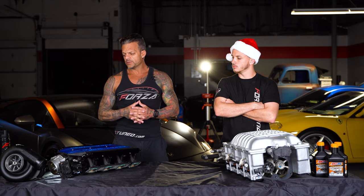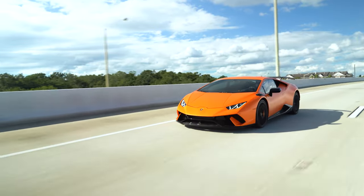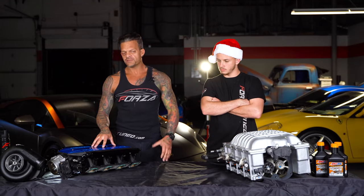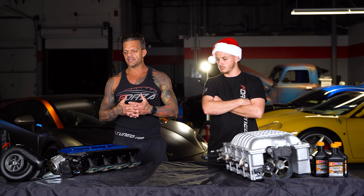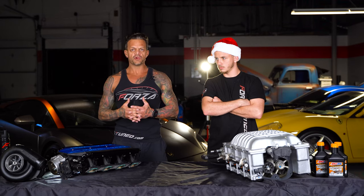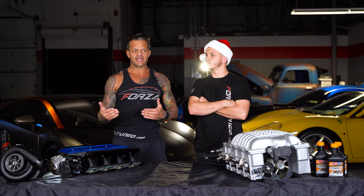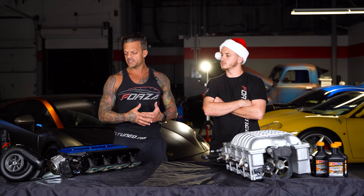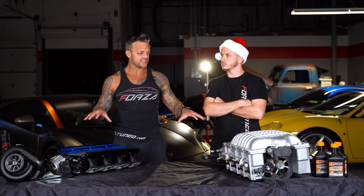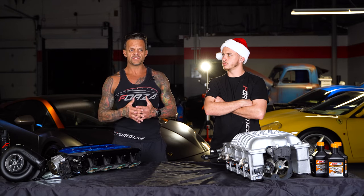The turbocharger is the most expensive route. If you strictly want the absolute most power and don't care about price or complexity, a turbocharger setup is most advantageous. If you want the most bang for the buck, one of the two supercharger options will probably suit you better. You also have to factor in what you're actually going to do with the car — if you're shooting for 1,400 horsepower that requires full-time race gas at $12–15 a gallon, so a turbo setup might cost a lot more money for something you won't achieve because the limitation will be the fuel you're running, not the forced induction.